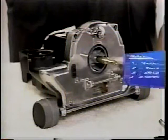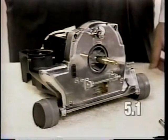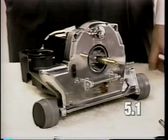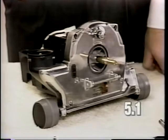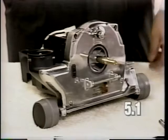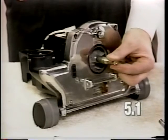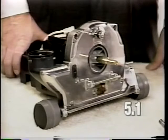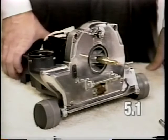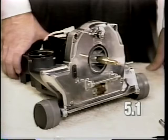If during your repairs you notice an excessive amount of arcing coming from the armature at the brushes, or if you notice an electrical smell, check to be sure the motor does not bind. It could have a broken or blocked fan blade. Rotate the fan pulley with your hand to ensure that it is not bound. If the fan is blocked, see section 10 of the video for fan and fan case disassembly.